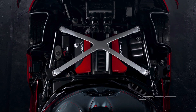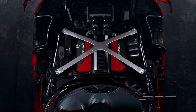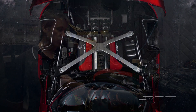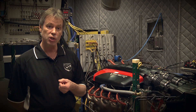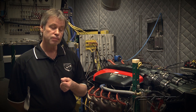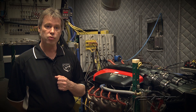We went to a sodium-filled exhaust valve, which allowed us to be more aggressive in our calibration with spark and fuel. We went to a forged piston for the same reason — it was able to withstand higher pressures and temperatures, so we could lean out the mixture, be a little more aggressive with the spark, and not compromise durability. All of these things put together, we were able to squeeze out about another 40 horsepower.